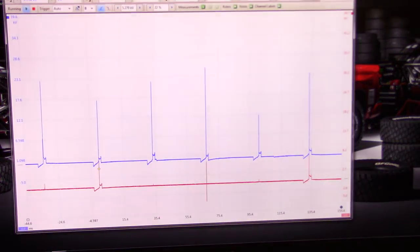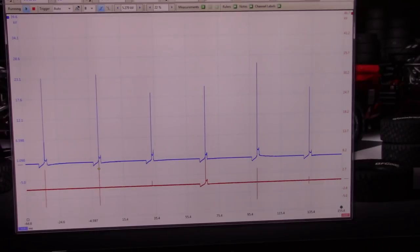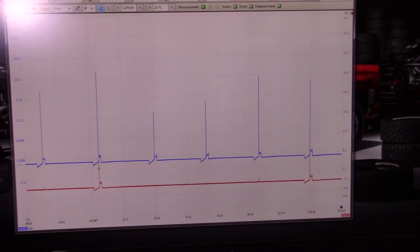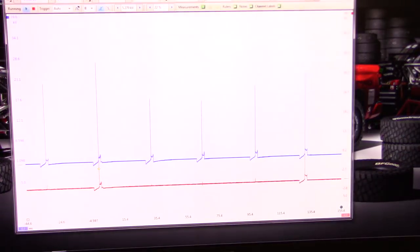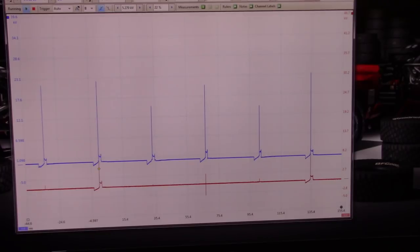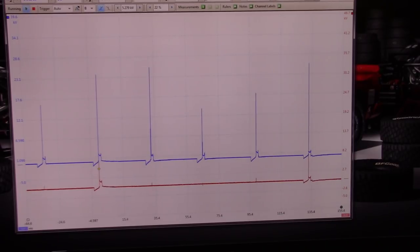Cylinder 3 just went up to 200 and something. But I don't see anything on the secondary that will tell me that I have a leaking injector or injectors in this case. So this is a very interesting case. I don't see anything wrong with this. Let me do a zoom.